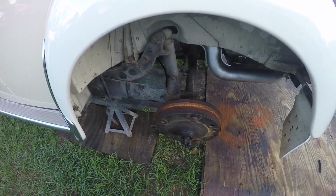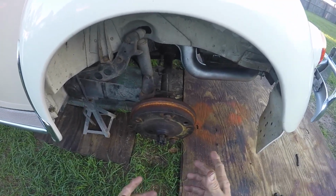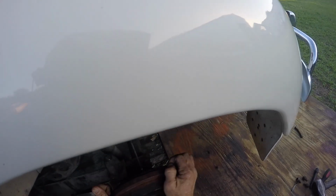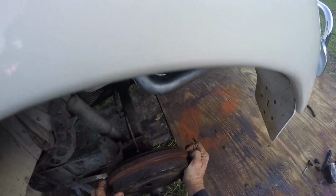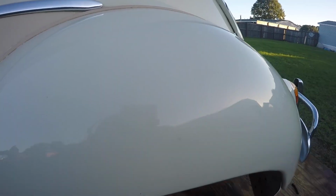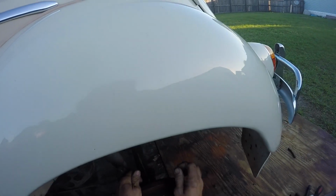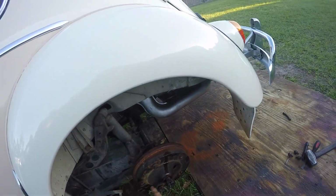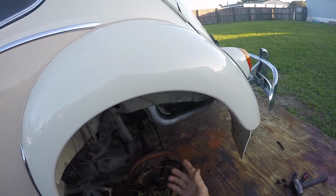But I can't seem to get to the front of the vehicle yet because he had a brake locking up, and you can see I backed them completely off. There's something not connected in there, and I've tried everything to get this off. So maybe it loosened up. So what I'm going to do is take this brake line out and remove the bolt for the wheel cylinder, and I'm going to turn this around and release the springs there, and hopefully it'll free up